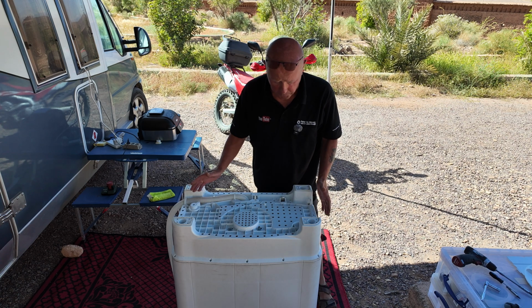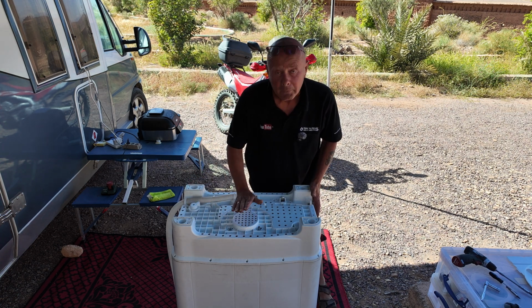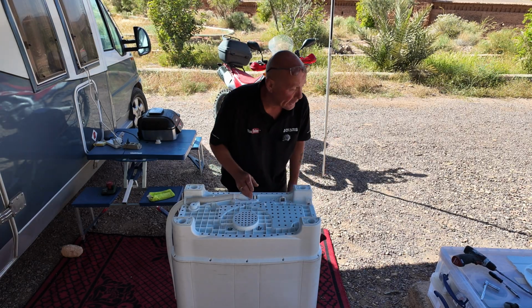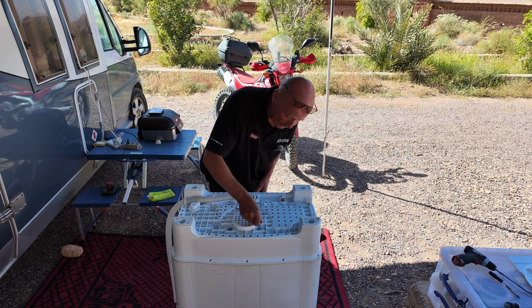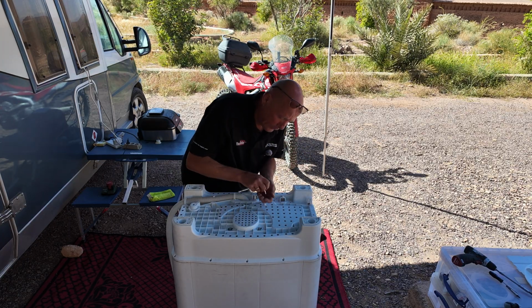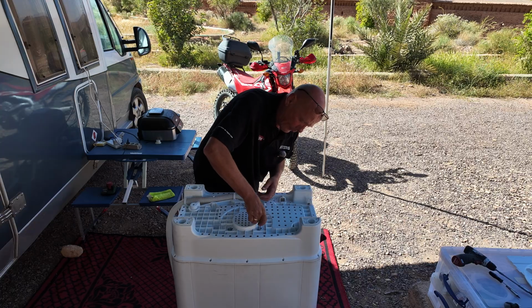Okay, for video purposes I'm actually going to disconnect the 2 motors. This means that the one motor that I took the belt off is going to drop down, so you'll need to support it from the underside. Now these are pretty straightforward. They have 10mm nuts on them, and you just need to undo. There's one locking one there, and then you have the main one.